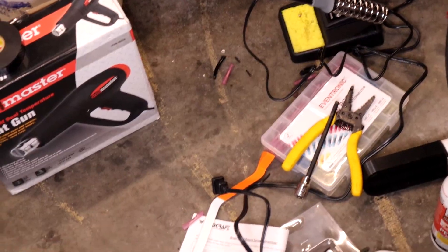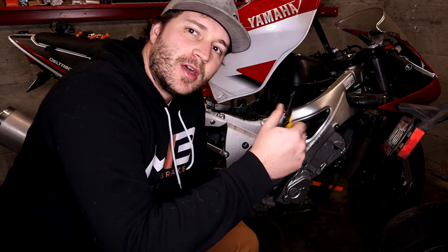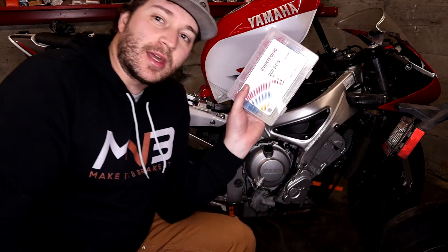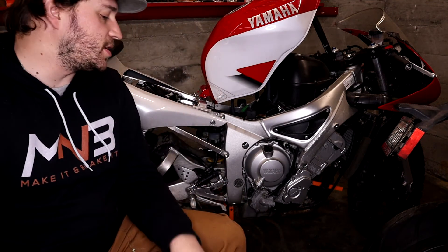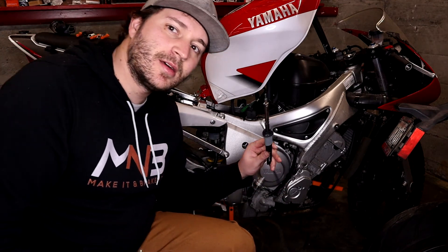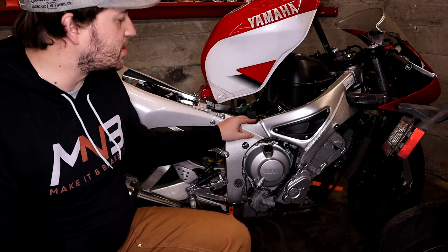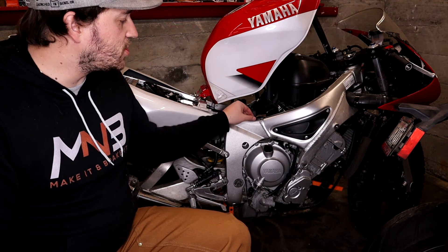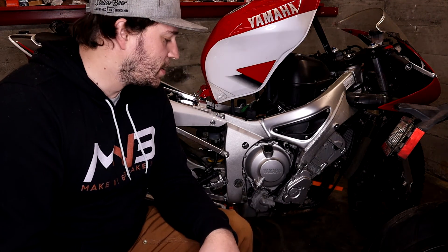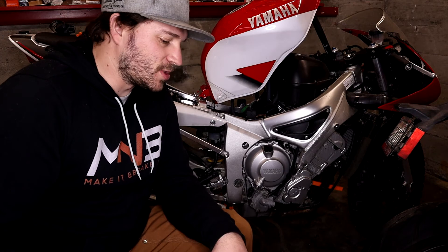As you can see by some of the carnage on the ground, we had to make a couple changes of plan. The crimper tool I was using wasn't working very well with the end connections I had bought, nor was it working well with the butt connectors I used on the headlights for the project ute. So I ended up pulling out the old Radio Shack soldering iron and ham-fistedly soldering a bunch of these connections. They have heat shrink over them and then I wrapped electrical tape over that. The idea is that if you solder, shrink wrap it, and put electrical tape, it's probably not going to come apart.